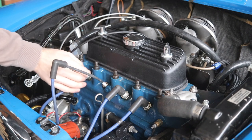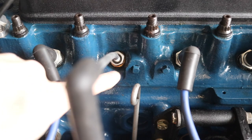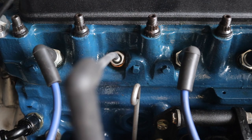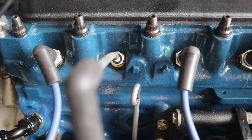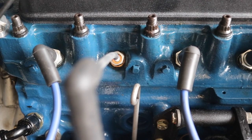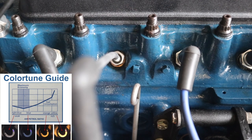Let's get closer up to this Color Tune so you guys can see what the color looks like. With the camera set up, I'm going to go ahead and start it up, and you want to look around the ring of this Color Tune to see what color it's going to be while it's idling. If it's firing yellow like it is right now, what that means is that the air-fuel mixture has too much fuel — too much petrol in it — which means it's running rich. The way to weaken that is by adjusting your carburetor. There's a small adjustment screw on the bottom side of your carburetor: if you turn it anti-clockwise it will make it leaner, and if you turn it clockwise, as seen from above, it'll make it richer. So let's turn that down a little bit and make it leaner.